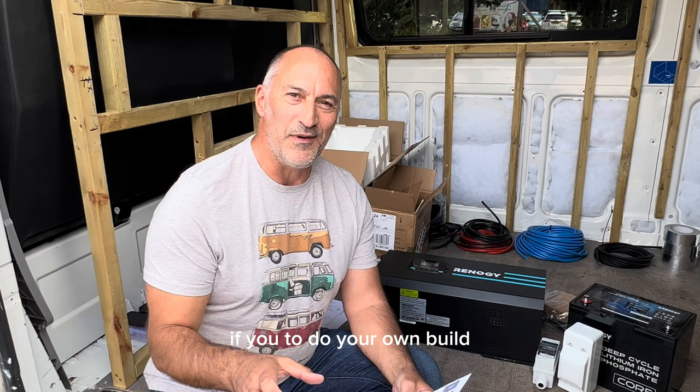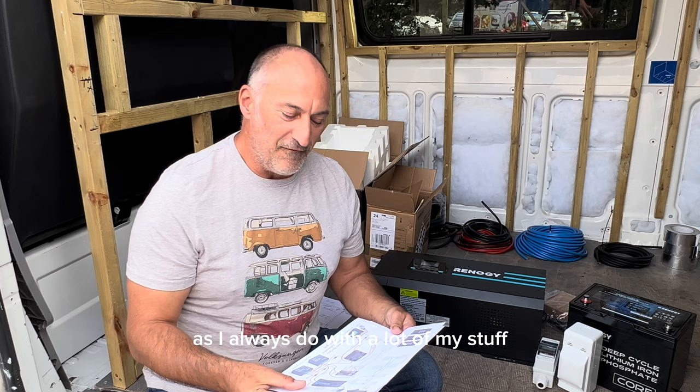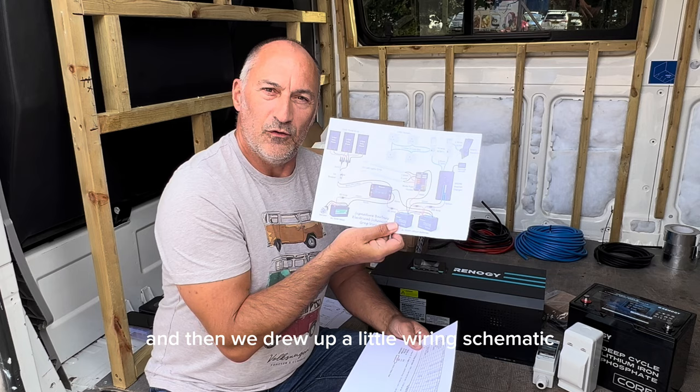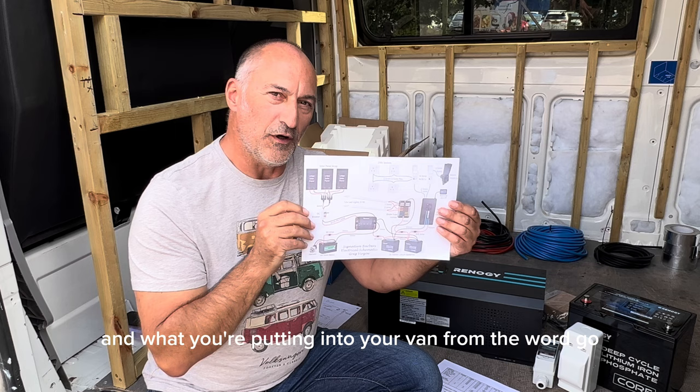Yeah, I think it's really important, as Tyler said, if you do your own build, as daunting as it may seem to deal with the electrics in the first instance, if you've done it yourself, then you know exactly where everything is. So if you do have any issues in the future, you're better equipped to deal with any problems. So what we started out with, as I always do with a lot of my stuff, is we got all of the detail from Tyler, what he wanted, and then we drew up a little wiring schematic. So it's just a simple way of knowing what you've got to connect to what. So this is the first thing that you need to do, really. Have a clear plan of what you want to do and what you're putting into your van from the word go.